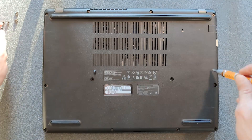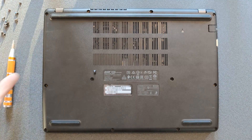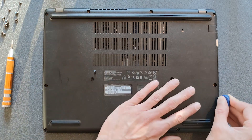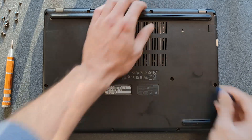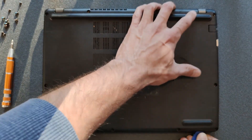To do so, remove all the screws on the back panel — I've sped things up a bit, otherwise it's going to be a very long video. You need something plastic, like a credit card or anything like that. Don't use your metal screwdriver — I've seen that many times and you're just going to leave ugly marks on your laptop, so take good care.